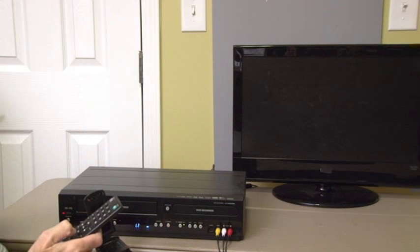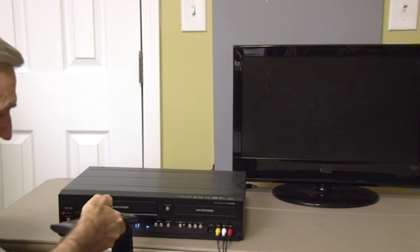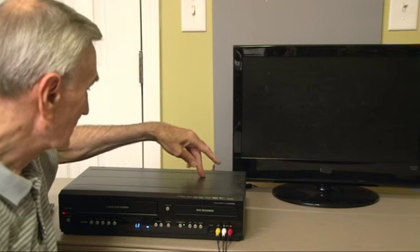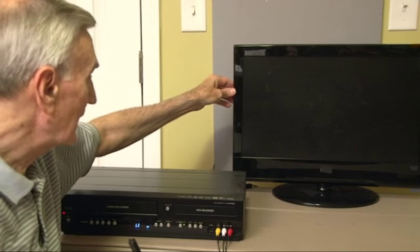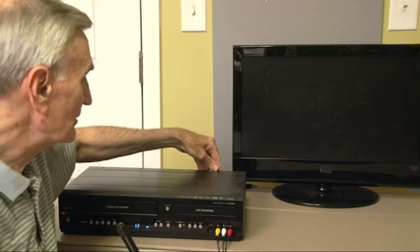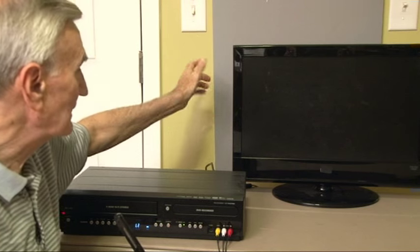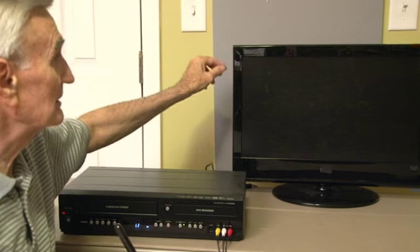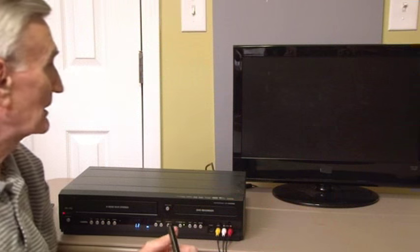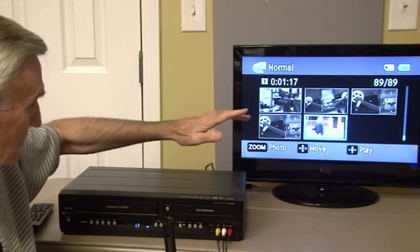You'll need to go and set with your remote to input from line two. Then you'll need to have your combo recorder hooked up to a TV screen. I've chosen the HDMI out from the combo recorder to the HDMI in on the TV screen. Now I'm going to turn the TV screen on — it will show you the thumbnails of the home movies that are recorded by the video camera.